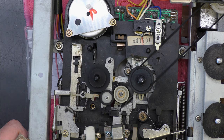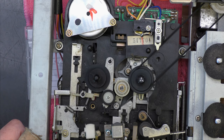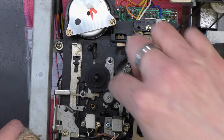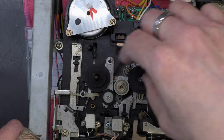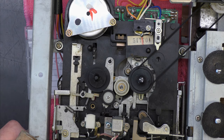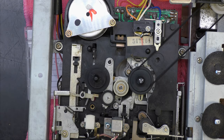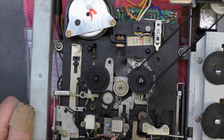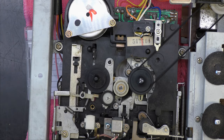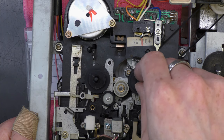Just looking at the mechanism, I can see this drives rewind and also drives fast forward. So what is supposed to drive take-up? Good question. Well, this ball is in contact, but the question is what else should it be in contact with. I also notice there's an idler here and I wondered whether that should be making contact. Okay, so there we go — we've got take-up again. So what should have been driving it was this idler here, and it seems to be connected to the pause control. A little push got it going — I suspect the grease is a little bit stiff. So we've got contact now, take-up — so that's good.